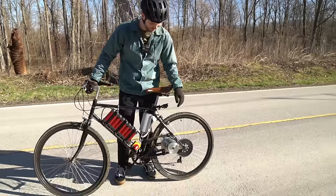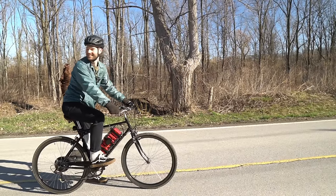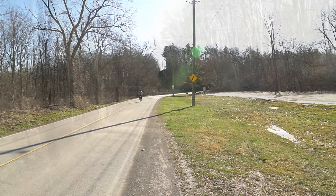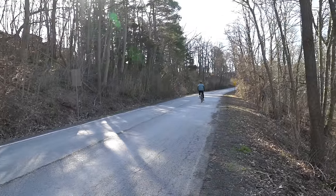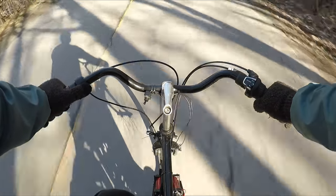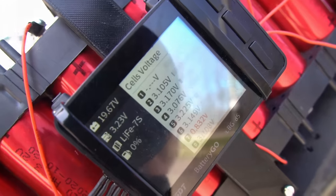I've added a larger rear sprocket and I've also drilled some holes in the motor casing, so let's see how this second test works out. The second test went much better than the first. The motor did not get nearly as hot due to the added cooling holes and larger rear sprocket, but the controller cut out after just 10 minutes due to low battery voltage. Two of the cell groups dropped to a terribly low voltage, and this is why you should always use a BMS.